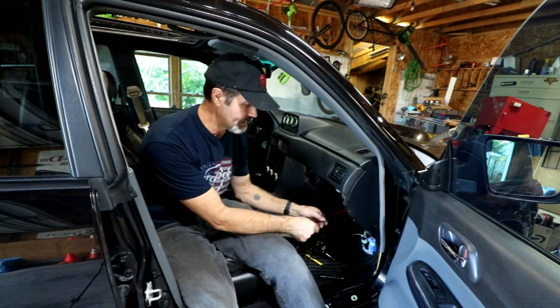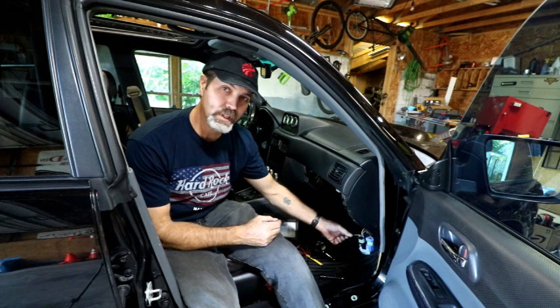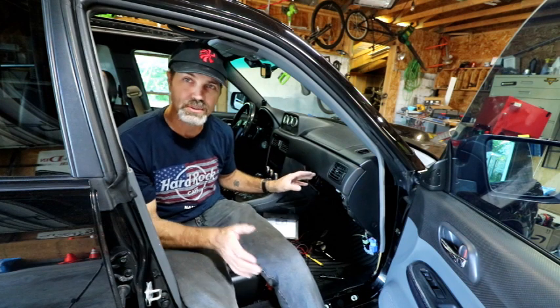What I need to do now is take my little test light back off. I'll take the wire on the relay side, put a barrel connector on it, and run a wire out under the hood to my new daytime running lights. The other wire I'll just put a butt connector on to seal it up so it doesn't make contact with anything — there's no power running through it, but I'm not going to chance it. This way I'm not messing with the resistor or the voltage going to the regular high beams.